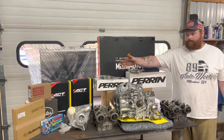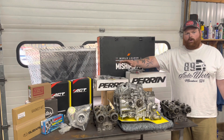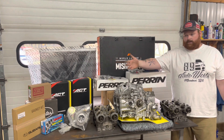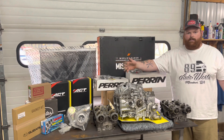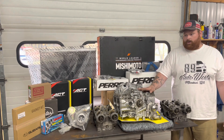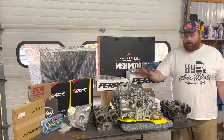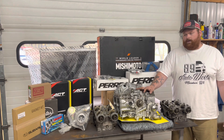We've got a brand new Subaru gasket kit — really there's no second to that. There are other options, but in my opinion that's the route to go because you get everything included, and they're about $250 online. We bought the 2.0 gasket kit, so the only thing we'll need to replace separately is the head gaskets since this will be a hybrid build.